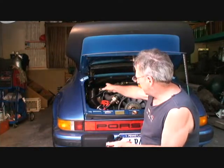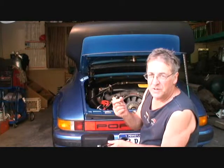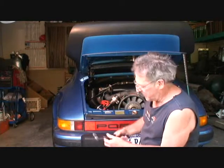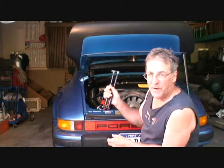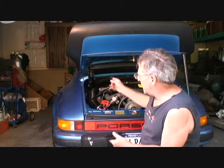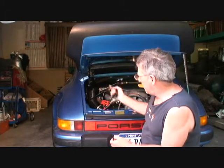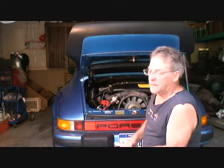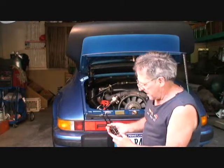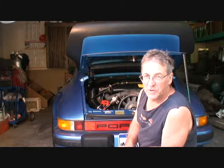But I notice on our hinge here we have about a 1/2 inch diameter. Now the reason I put these spacers in here was to keep these two pieces separate. Now if we have that much space on there and we have one strut on the inside of that opening, and then we're going to put another strut on the outside, then we're going to put our bolt through here. That should be a pretty simple solution to this problem.